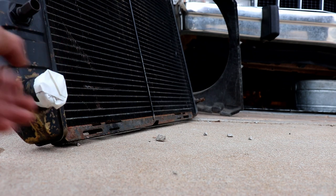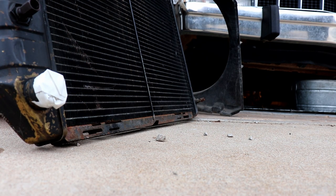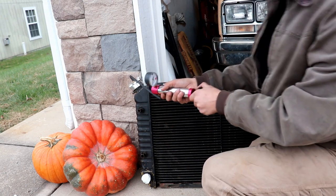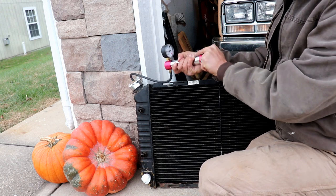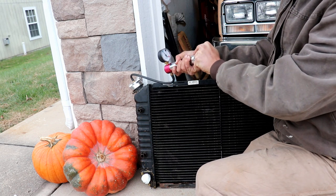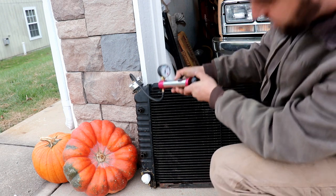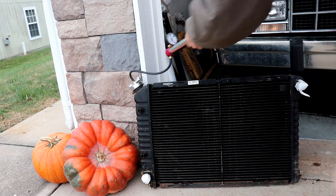It's doing a really good job right now — it is full of water and holding up. We're going to see if we can successfully perform a pressure test. You can see it bulging and I'm up to 13, 14 psi — still holding. I'm at 15, 16 psi, which is what this radiator is supposed to hold.